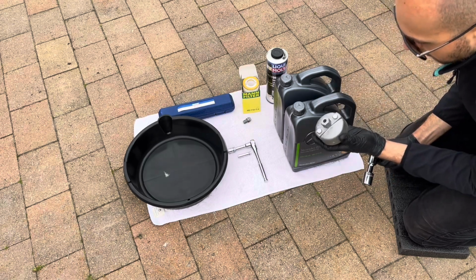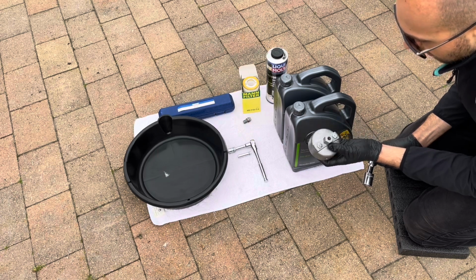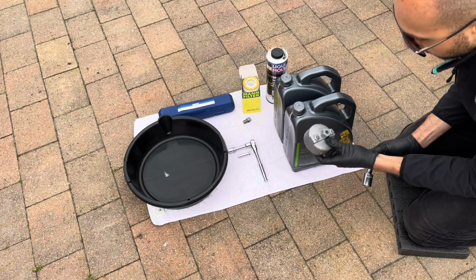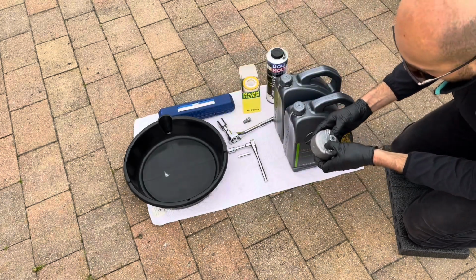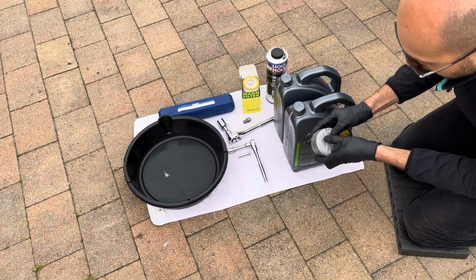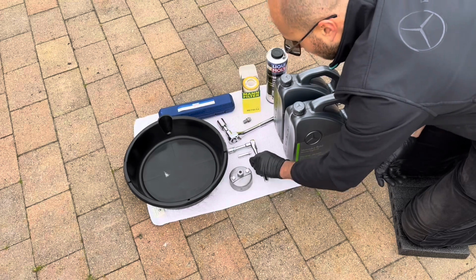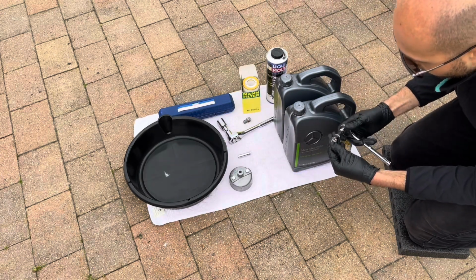You can pick this up from any dealer, and it will work on a variety of Mercedes-Benz engines, and it wasn't that expensive, so I really recommend that. The part number, if anyone wants it, will be A103-589-020900. And I also have a 3/8 drive ratchet with a 13mm socket on the end.